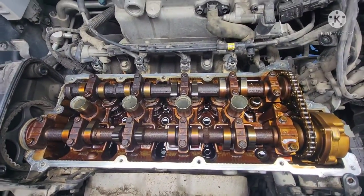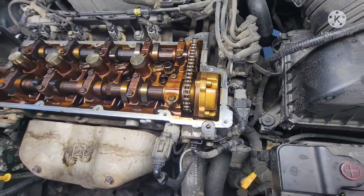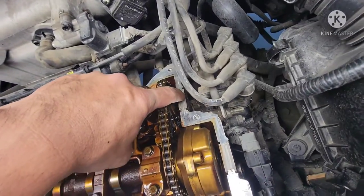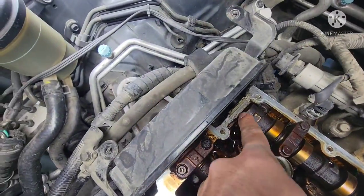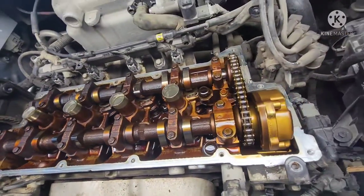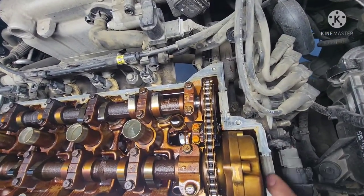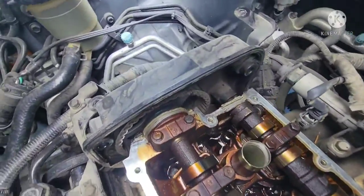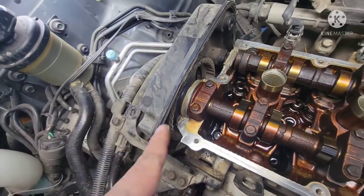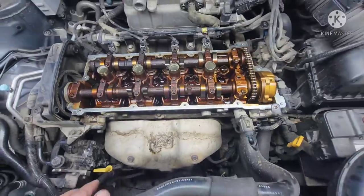I cleaned around the head — you can tell it's nice and shiny on this side, all around to the back. Now I know why there was gasket maker on this side. There are little plastic cam caps right here — two on one side and one on the other. These are cam caps. You put silicone RTV on those — make sure it's clean and flat on the surface. I used a razor blade to clean them off. We'll put silicone on each side and around the cam caps. It's tough to reach that area but I'll put a little dab of silicone RTV so it seals properly.